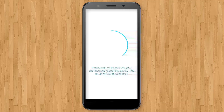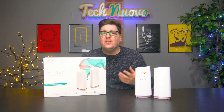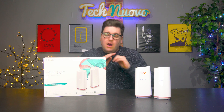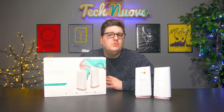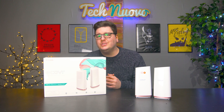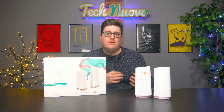This is where the waiting begins as your existing network hunts and connects to your main device. Once connected, a solid white light will show. Once your main network is set, you plug in your second receiver unit and follow the on-screen instructions on your phone to connect the receiver to the sender. Everything is done inside the app, and once that's complete the setup is done. Your phone will be set up on the network, and on any other wireless devices in your home or office you will see the new network appear, connecting as you normally would with the new password you've set up in the D-Link app. Once your devices are connected, they will appear in the app as well.